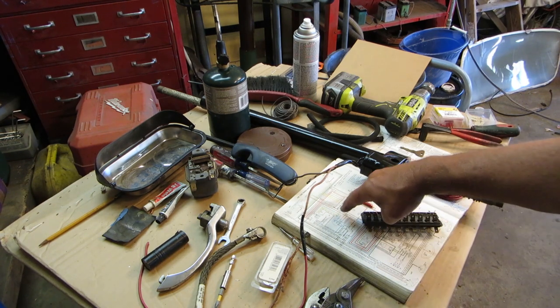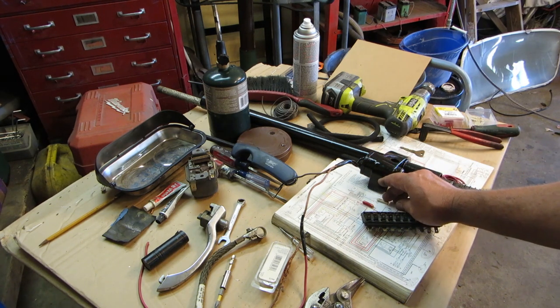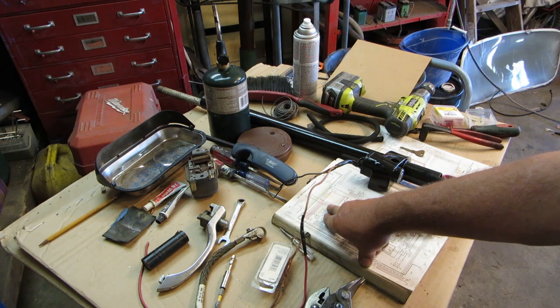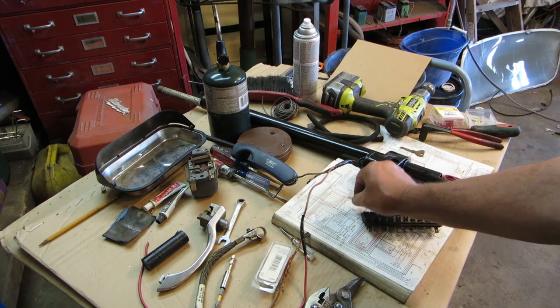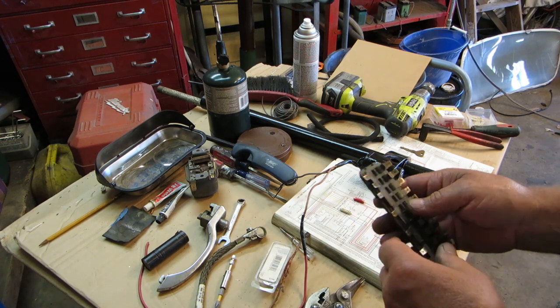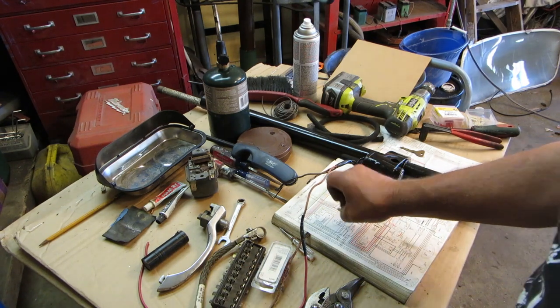If you load these all up with 16-amp fuses, and you have a short in a wire somewhere, 16-amp might be more amperage than the wire will hold. And so your wire will get famously hot, start melting the insulation, catch on fire. So it's very important to follow which fuses are there. And if you have a fuse that's continually blowing, you have a short somewhere. A bigger fuse will not fix the problem. A bigger fuse will cause fire. So don't do that, okay? Shine up all your connections before you put that on there. I showed you that. Fuses, we'll set those aside.